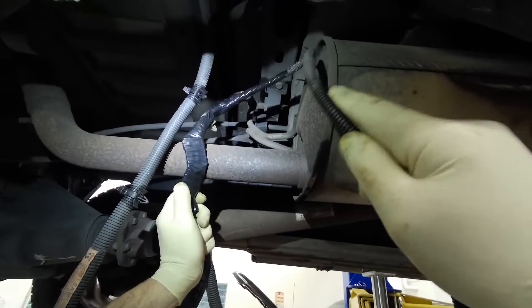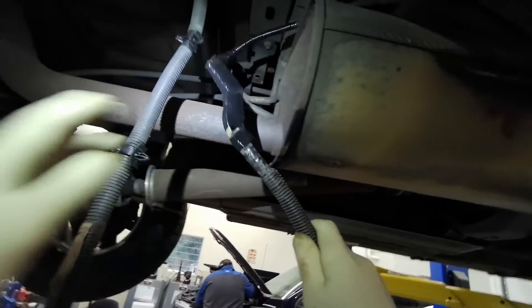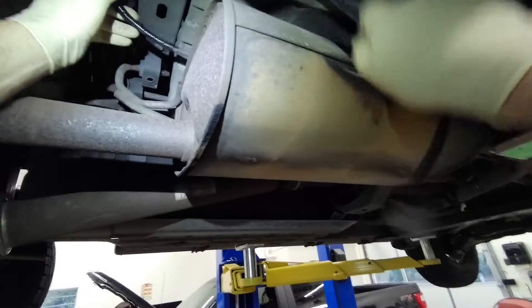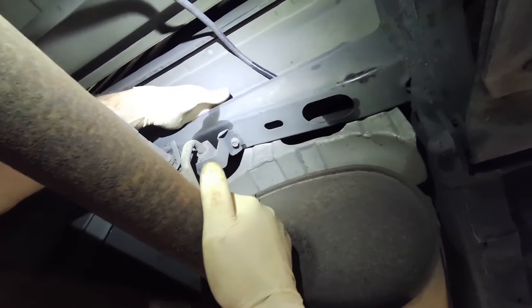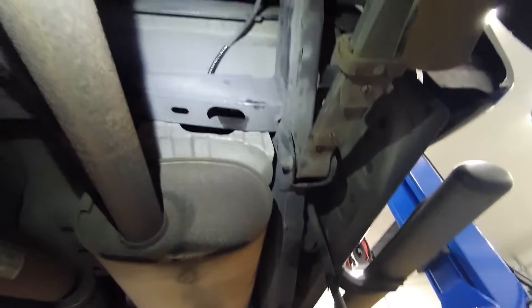I got this all repaired. I went ahead and cut both wires and spliced in a small section, soldered it in, put some heat shrink around it, and then taped the whole thing up. Looks really good. I just got to snake this wiring back where it belongs. It would have been easier to take the whole thing out but couldn't get it between the cab and that cross member. It's going to fit back in there nicely — let's see how we did.